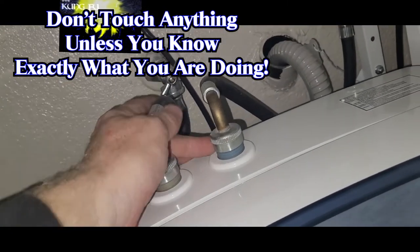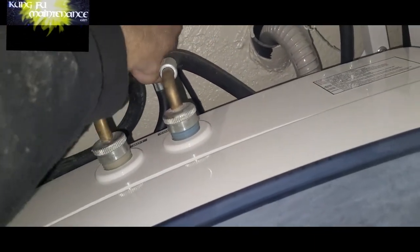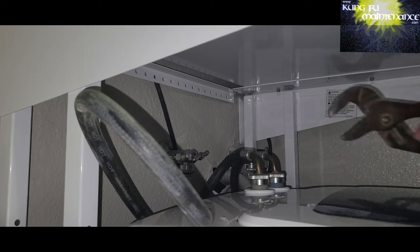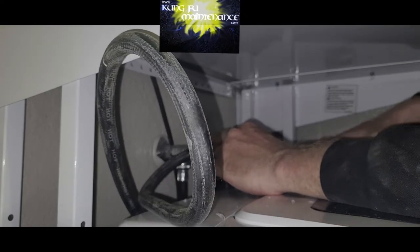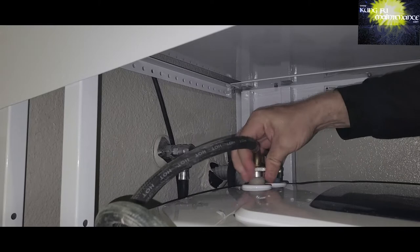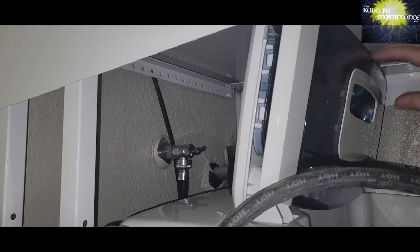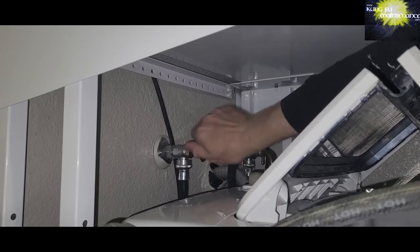Just like dribbling through, so checking the hose here, the hot side. Water is turned on. Turn the water off and stop the machine. Now I'm going to disconnect the hose and to prove that we have hot water. So just take the hose off here, careful not to lose the gasket that's inside the hose end. I'll position it here and turn the water off. Turn the water on. We definitely got water, got flow.